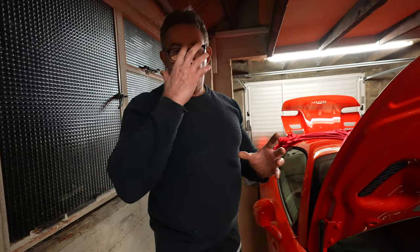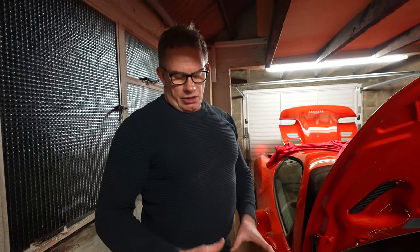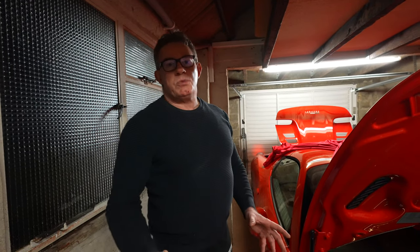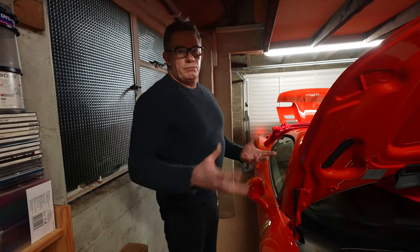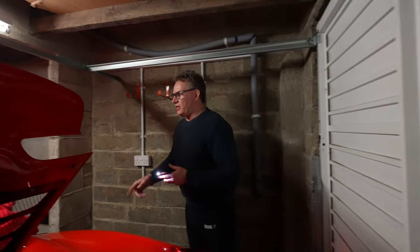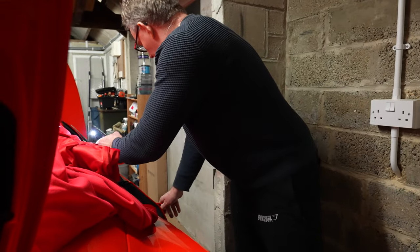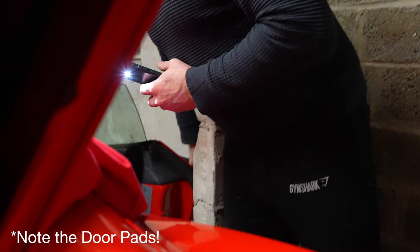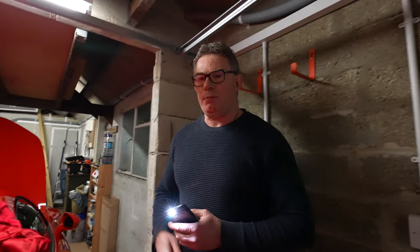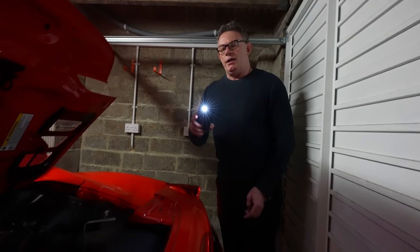Because the tire is over-inflated it's less saggy, so you get less chance of flat spotting. The optimum approach is to move the car forwards and back a small amount to move it off the same piece of tire, and to over-inflate the tires. The car is now further back — as far as we can go given the garage pillar — but it gives us enough of a new tire section to reduce flat spotting.